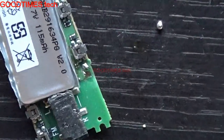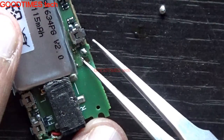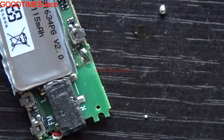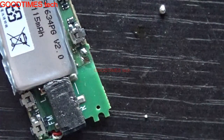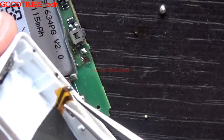The camera is taking time to zoom and auto-focus. This point here and this second point are for connecting the NFC antenna. As you can see on this side also, the track is damaged, so we need to solder here as well. We will clean this part too.